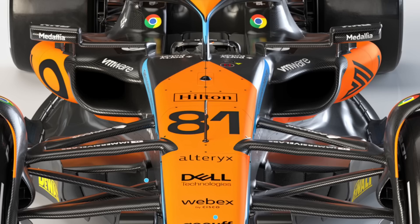Moving a bit further rearwards, you'll see this subtle detailing on the inboard floor fence. I've confirmed this in the physical model, not just in the renders, so I would say this is probably real. Many teams have run extensions of these fences up to the top of their legality box. What's interesting about this particular extension is you can see how backed off it is at the top — how much it's curving back — which implies they want to clean up the vortex along the top and depower it, make it not too strong but fairly persistent. They're probably also trying to minimize any chassis losses along the side, because losses can build up as you move further rearwards, and a very aggressive tip could cause those losses to explode a bit more.